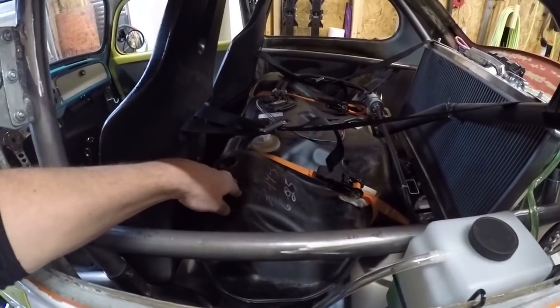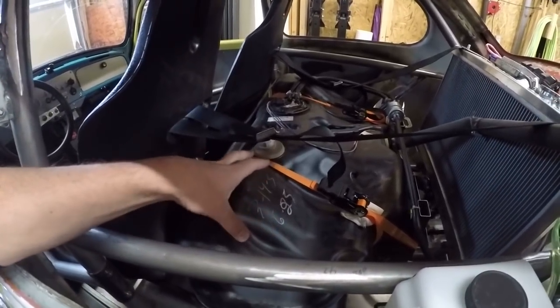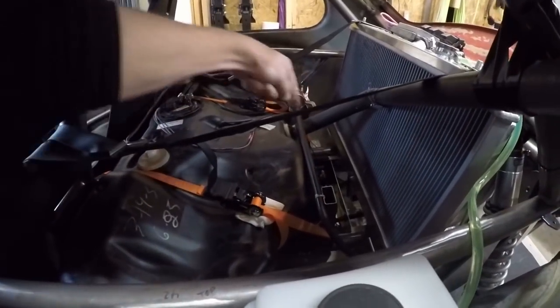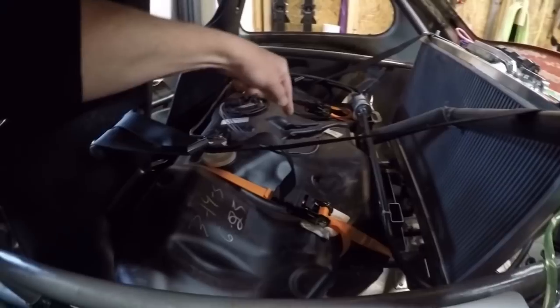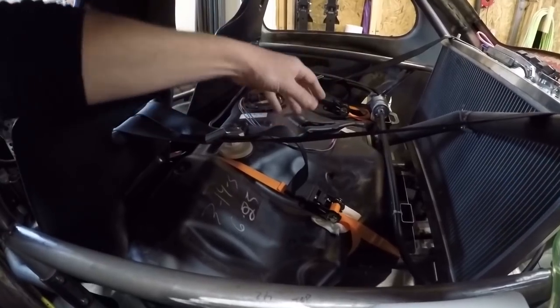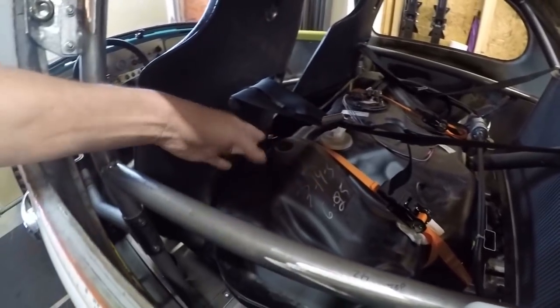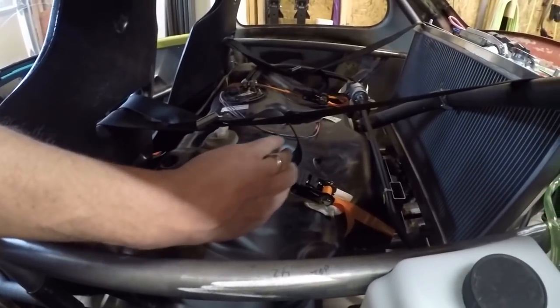The first thing I did was take measurements for the fuel cell. It's going to be about 10 gallons, which is low, but I'm drawing it up so that it will clear my electrical box down here, and right in front of the electrical box is my shifter coupler — I don't want to cover that because I'll always want to be able to access it on the trail. I've drawn up a fuel cell that will mount low right behind the seats and go right up to the shifter but won't cover it. My plan is to make the fuel cell and then fabricate a cradle with straps that hold it.